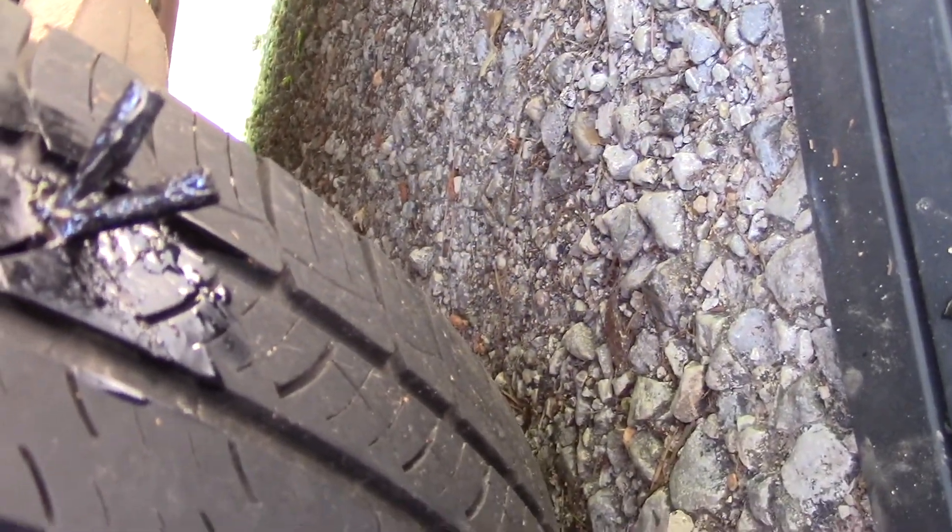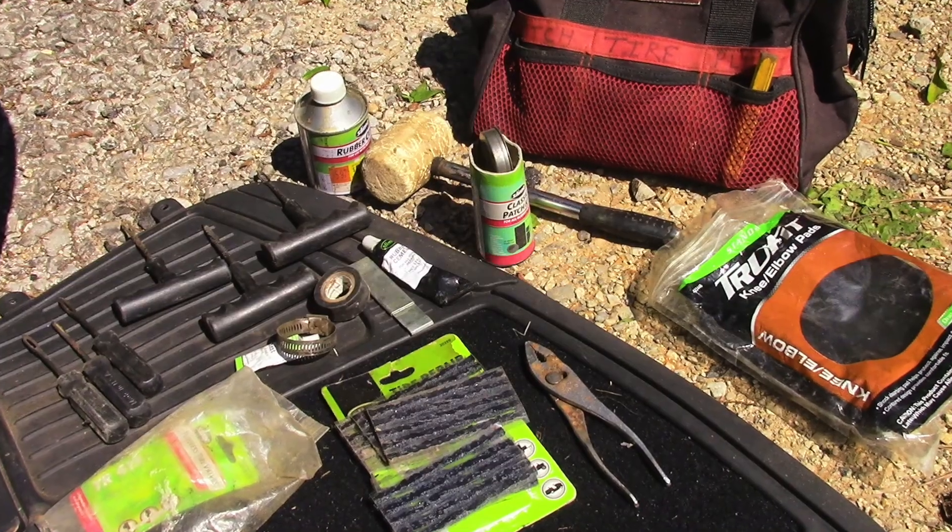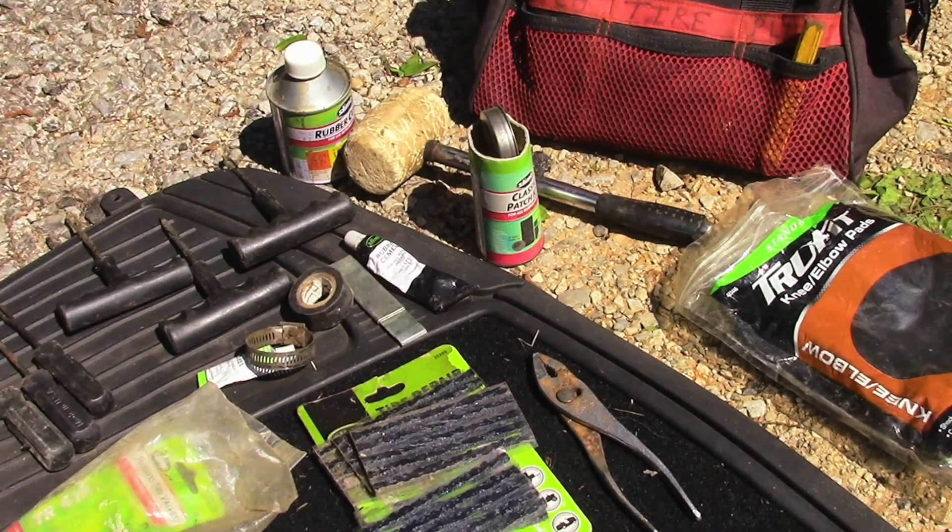That is what was in it — that is a roofing screw. Now we're going to trim it with our box blade. Some people call this a hawk bill. I'm going to trim it off. And you can see how some people say you could, in theory, cut that plug in half — but I just wouldn't do that. It is kind of hard to do with one hand. Okay guys, now we're back. You can see it's not that hard to do.